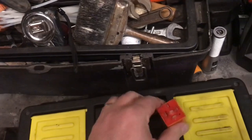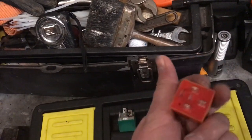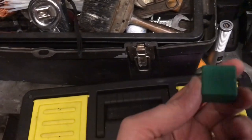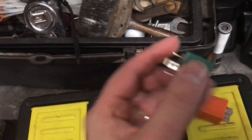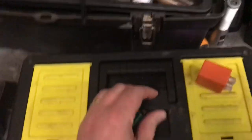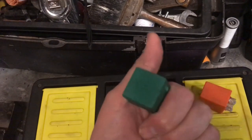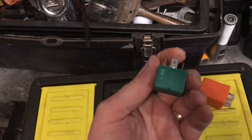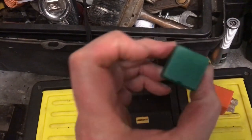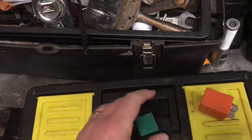If you have a problem with your rear window heater, the orange one is what you need — that's a 5 pin 30 amp. The heater fan relay is a 4 pin 25 amp green one. Just to complete the trilogy of problems I was having — hopefully this helps and finishes it off nicely, because it's now fixed. Thanks for watching, and hopefully this really did help and didn't send you on too much of a wild goose chase.